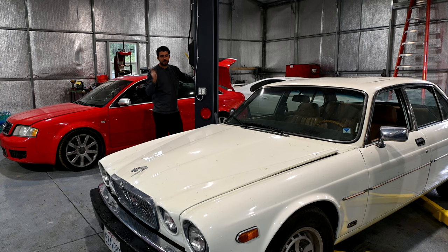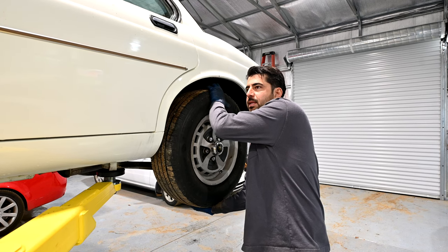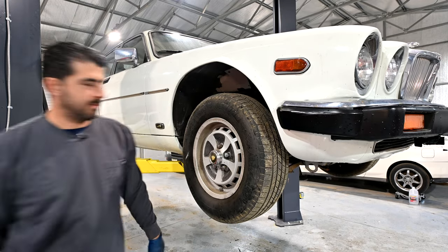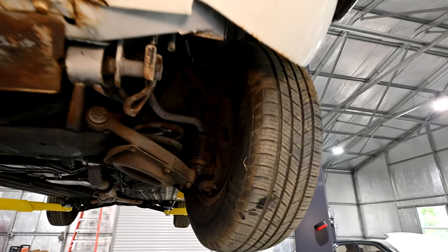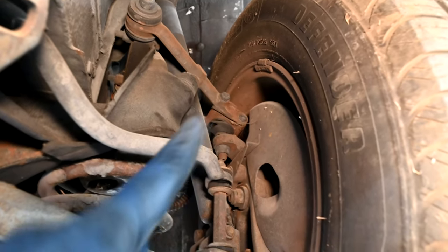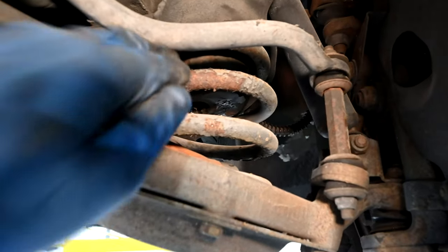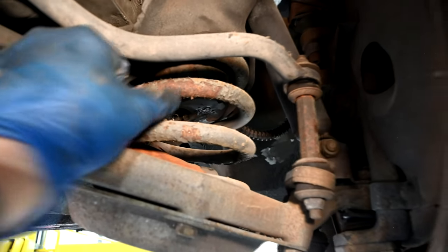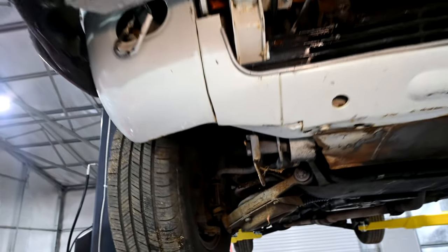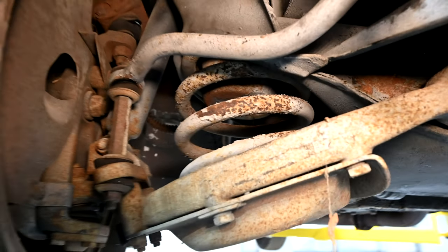Next, we'll raise the car and inspect the suspension and drivetrain from the bottom. Let's check the tie rods and ball joints — left front is okay, left rear is okay, right front has no play, and that one's okay too. On the driver's side front wheel, the boot on the upper ball joint is torn, but it doesn't have any play in it, so we're not going to fix that. The boot on the lower ball joint looks okay. Our spring here has seen better days, and if this was my car I would look into replacing it, but it's still in working condition. Front passenger side is more or less the same story — torn boot on the upper ball joint, and the spring on this side is also a little rusty but in better shape than the driver's side.